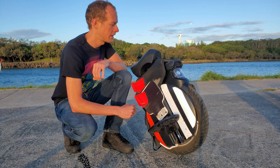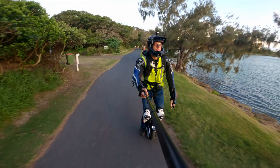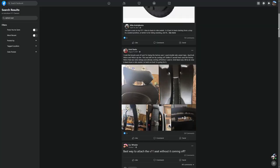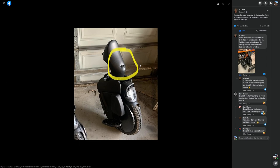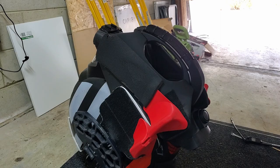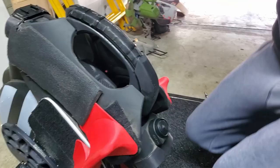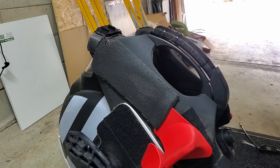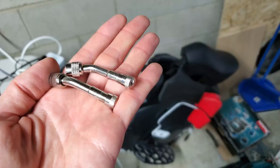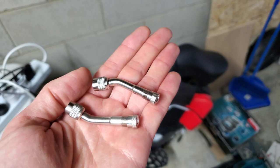I find I'm perched at the front of the seat. The seat can be quite dangerous, as the slippery Velcro can pull away. What's suggested is running a zip tie through the front of the seat so it can't tear away. Instead, I thoroughly cleaned the surface, sanded it, cut into it with a knife, and used two-part epoxy glue to weld the Velcro onto the seat. The reason it needs to be removable is because of the top suspension chambers — you have to remove the seat to access them to add pressure. Some people have added valve extenders, but these can leak and cause more issues.